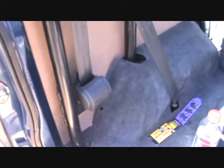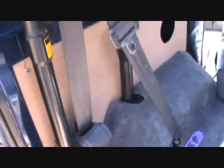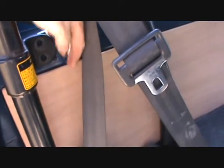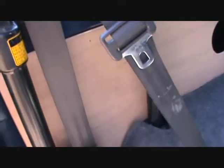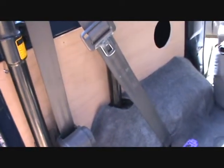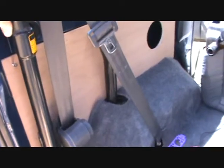The first thing you've got to do is loosen off your roll bar. Otherwise you're not going to get this panel in because of where it bolts in up here — it's not going to allow you to move it over the wheel arch down here. So you've actually got to unbolt it. It's probably easier if you're unbolted anyway. Just loosen all the bolts up and move it out, that way you can put your panels in and drill your holes in.